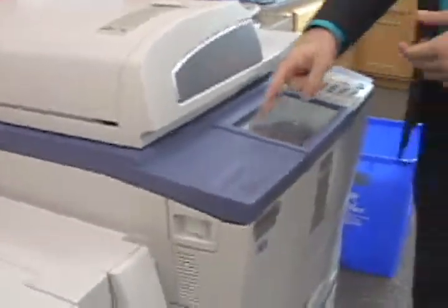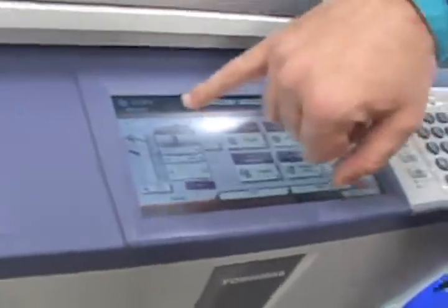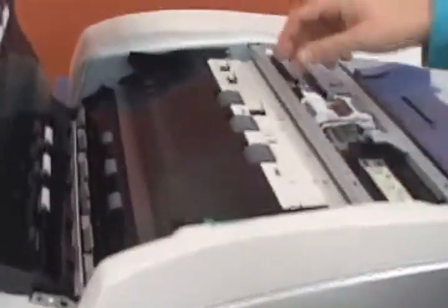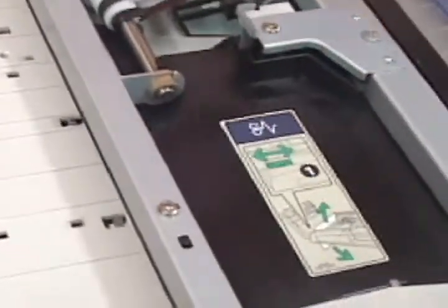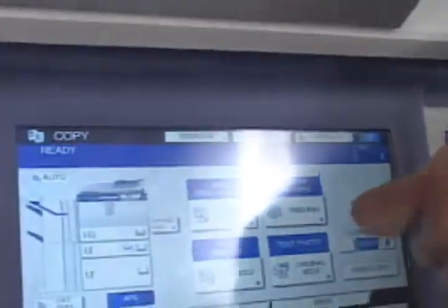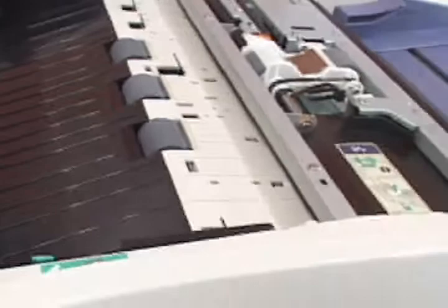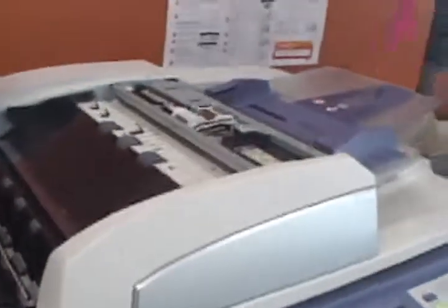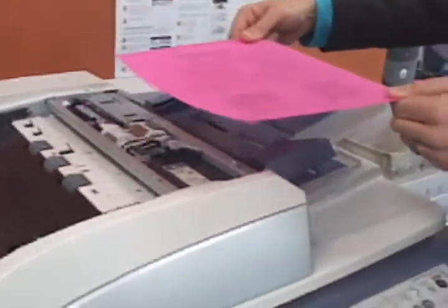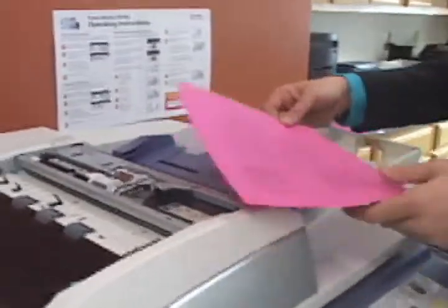From a jamming standpoint, when a machine jams it'll show you on the user interface where on the machine it's jammed. That figure looks like a couple of rollers with some paper jammed in between — that's what it's going to look like on the user interface to show you where the jam is. Anything highlighted in green is where you go to remove your jams. When removing a jam, take the paper from each corner and pull slowly and easily out of the feed tires. If you pull from one corner only, you can tear a corner — that can get caught in the gears and create another jam, leaving you with a service call situation.